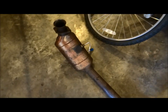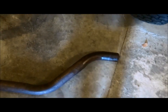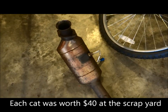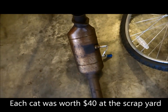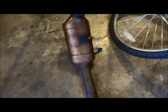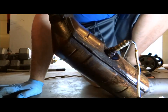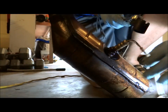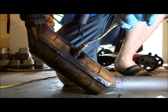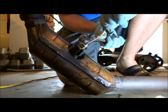Okay, well, with enough banging with the hammer right here, where my toe was, you just bang until you can get this thing off. And you don't have to take off the oil filter, although it probably would help if you did. So I'll go ahead and take that O2 sensor off. Okay, now it's time to take off this O2 sensor, so you're gonna need this tool, come down in here, take this thing off.